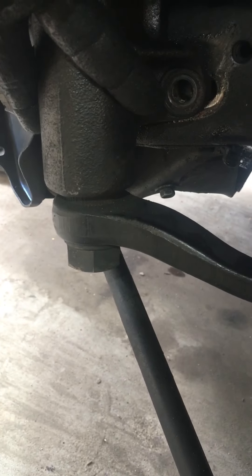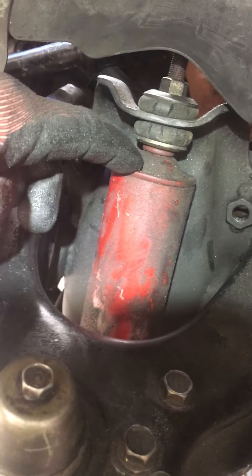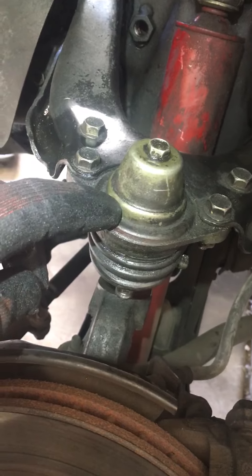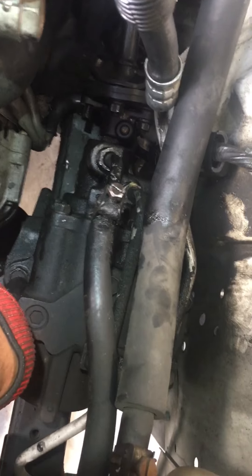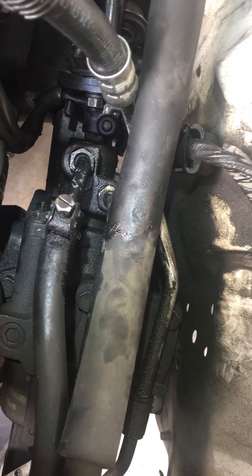Remove these two giant bolts, and obviously remove the control arm bolts that are behind the shock. I also have to remove the airbox in order to loosen this bolt from the power steering pump. Do not completely remove it — unscrew it about 75 percent of the way. Here's the steering column and that's the control arm. Once you remove the other bolts down there, remove this one too — it also has a nut underneath, 17 millimeter — and just barely leave it on.